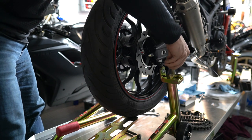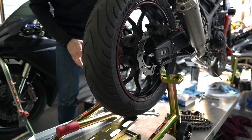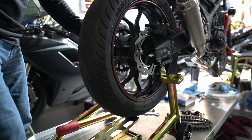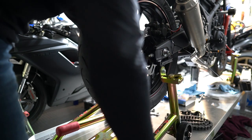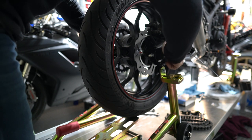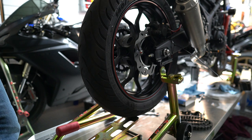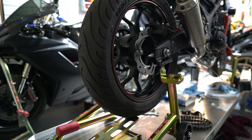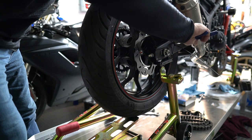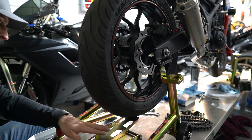There we go — now I'm just going to put this in place, put the nut on, and I'm not going to tighten it too tight for now because I want to be able to readjust everything with the chain and figure out the length required. Now that this is installed I can simply use my side cutters and cut the zip ties I put here as well.